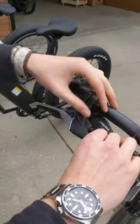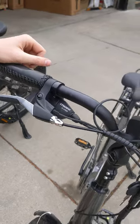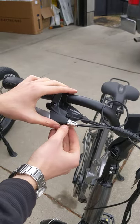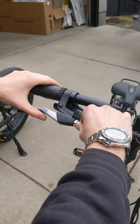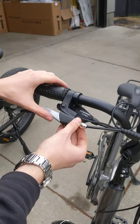How to quickly adjust your disc brakes if they're feeling a little too tight and a little squeaky. First, you want to loosen this collar. This is how you actually adjust it — you want to go about a quarter turn at a time, then tighten this back down.